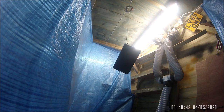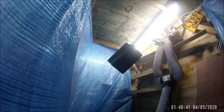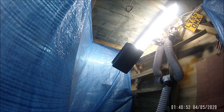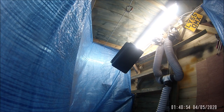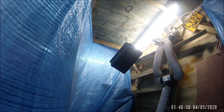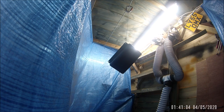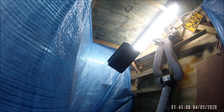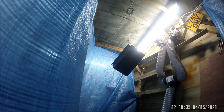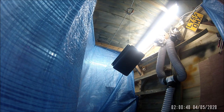That's the first coat. I'll give that 15 to 20 minutes - a bit longer than I've been giving it to cure - then stick another coat over the top. I think that'll be enough, and then leave that for about an hour, put the stickers on, clear coat it, get it back on the bike and ride the thing. Okay, coat number two - I'll tack cloth it all off first to get any surface dust off and then give it another coat.